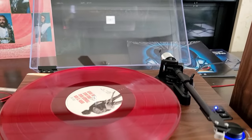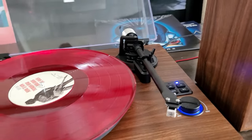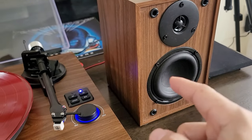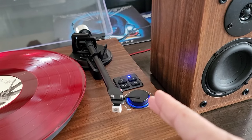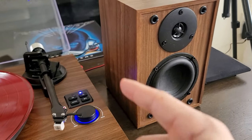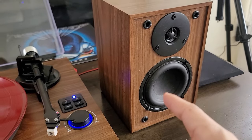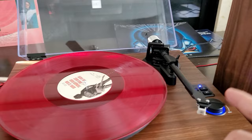Another pro and con: the speakers are bassy, which is a pro, but because they're so bassy you get distortion after about 60 to 70 percent volume. So when sharing or playing via Bluetooth, you should tune your equalizer on your device and cut the bass, because it will get distortion above 65 to 70 percent volume.